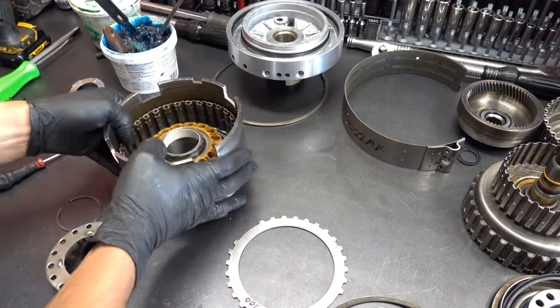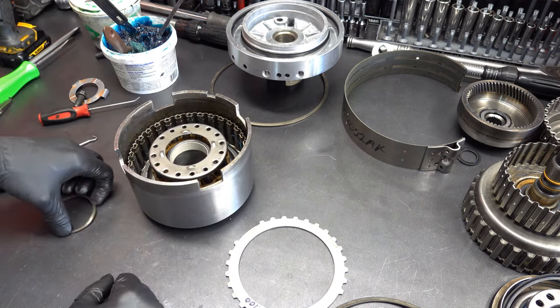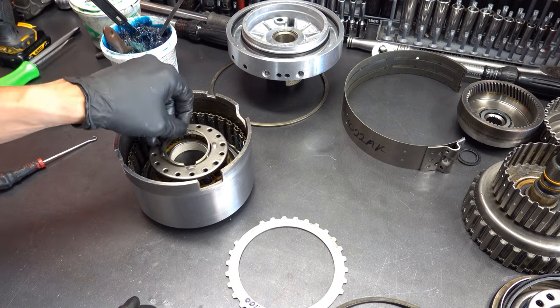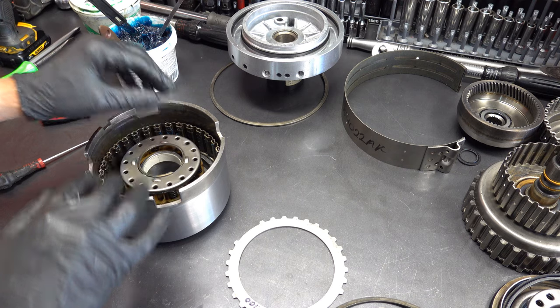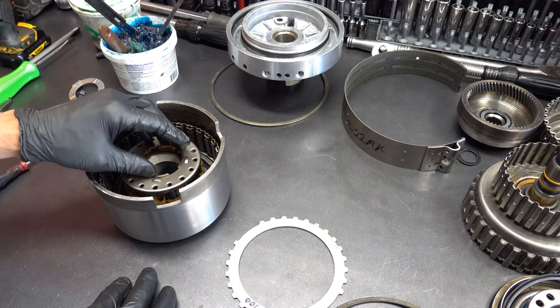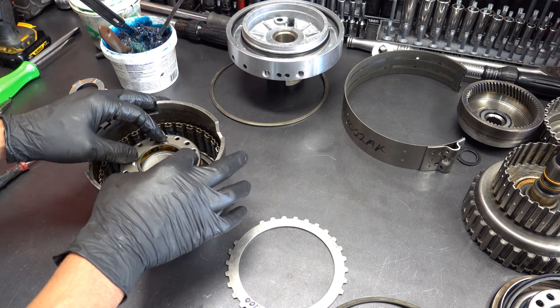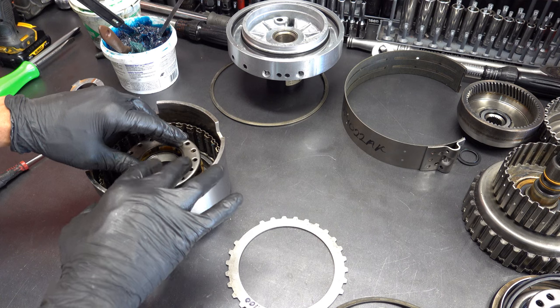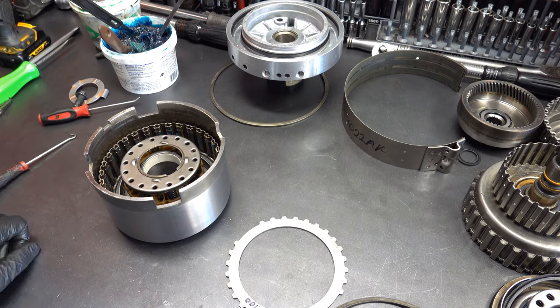Okay, I just want to make sure that you line all that up. As far as where you put the spring retainer, it doesn't matter, but orient your snap ring like this, so that when you go to the foot press or your spring compressor, you make sure all four engagement locking tabs are making contact with the snap ring so there's no gap. Okay, let me seat this and then we'll come back and install the clutch pack.